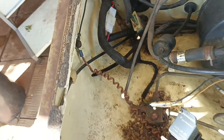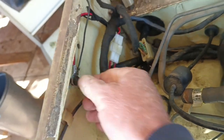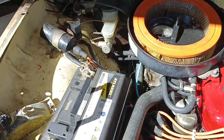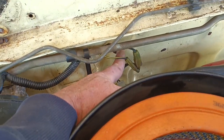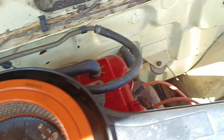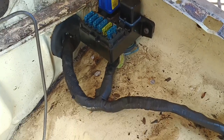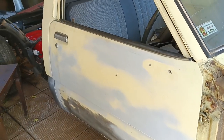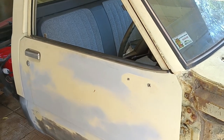You're going to get faced with ground issues and electrical problems, so a good understanding of auto electrical is going to help you out quite nicely in this project. This car honestly wasn't too bad, but it did need some work. There was a heavy duty cable coming through the firewall completely unfused. We've redone the fuse and relay box - there were a few things that could have become problematic.